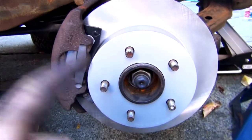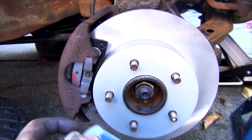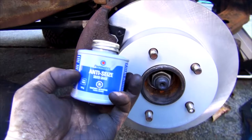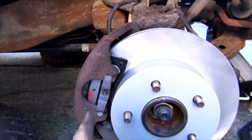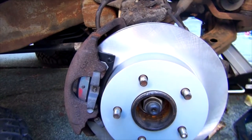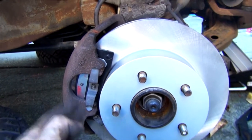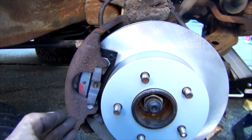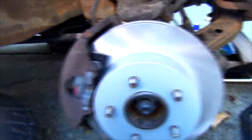If you have to use any grease while doing your brake job, go get brake-specific grease — there's a specific grease for that and it's usually without carbon. On anti-seize: as long as you clean everything well and there's not much rust, you're fine. If there's a lot of rust on your bolts it probably means you should change the bolts. It's nice to have a buddy who can help run you to the parts store, or have a second vehicle available.